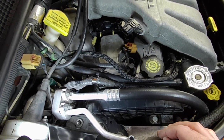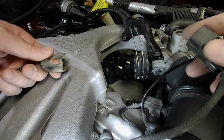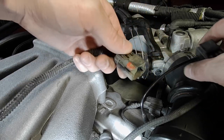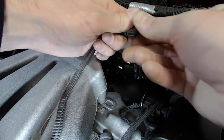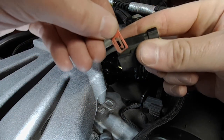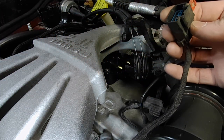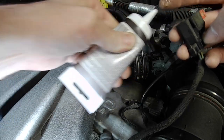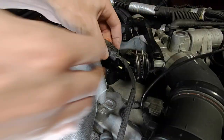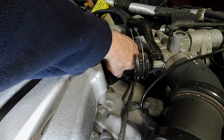It's time to plug the new coil back in. The coil is missing that red lock tab, but I've got a little pigtail I saved off another Chrysler harness just for this reason. Before we put that plug on, we're going to put some dielectric grease on it. I'm sure I have it locked now — push that lock tab in.